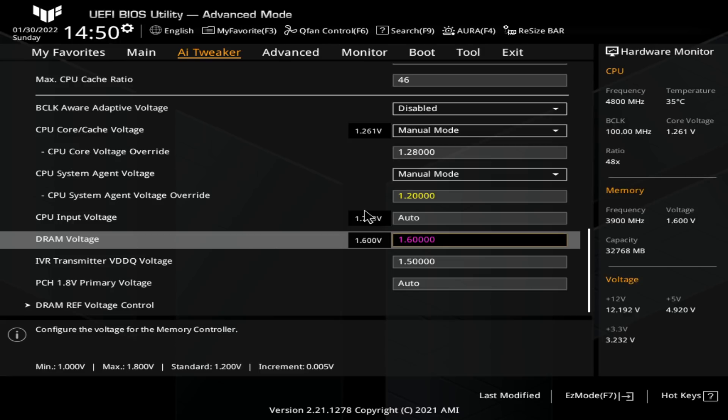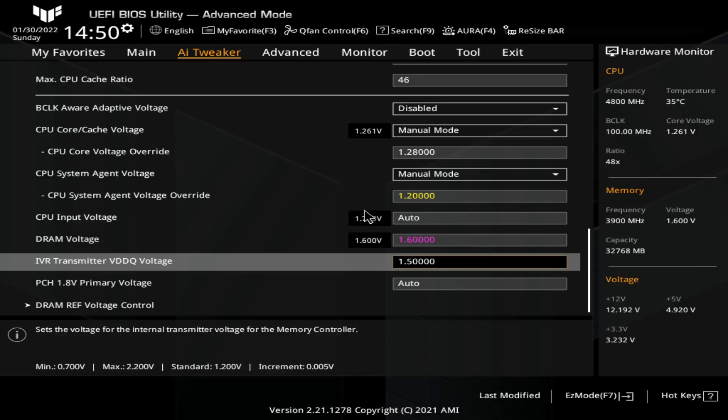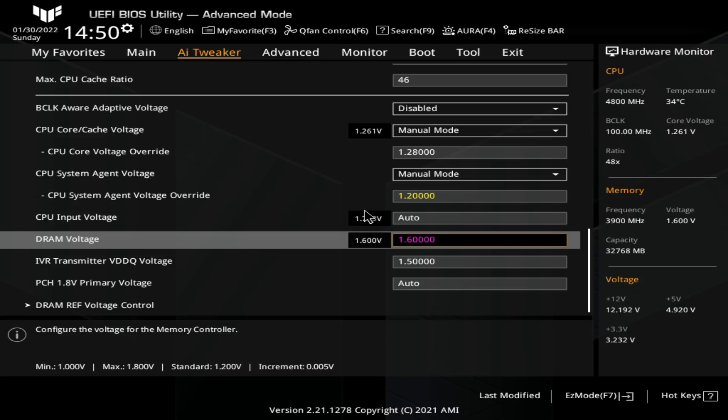If you were actually setting this kind of overclock up in a case, I would be very concerned about the heat output of your GPU. The RAM itself does not produce a lot of heat, so the bigger concern is everything around the RAM heating up the RAM. Though honestly at 1.6V, even the RAM is gonna get kinda warm if you don't have great airflow. If you have a big power-hungry GPU, you probably want to run your memory stress test at the same time as a GPU load test. I hate recommending FurMark, but FurMark is really good at not loading your CPU too much. The issue is most other GPU stress tests use so much CPU that they'll stutter and slow down if you're also running a memory test. I run open-air test benches, so I don't have to worry about GPU heat getting trapped inside a box.